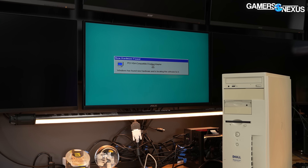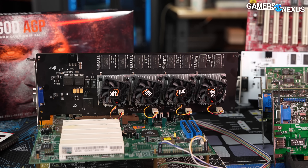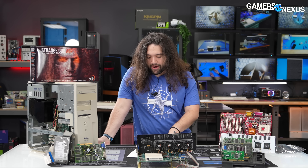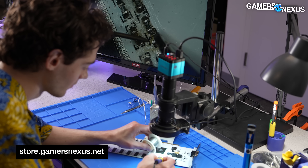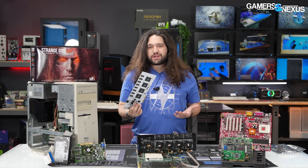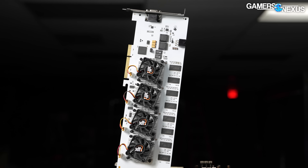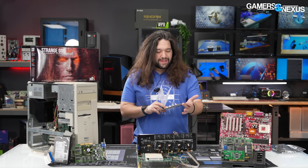We had constant resource conflict problems on the 8K3A due to the unusually high amount of VRAM — the card is modified by Anthony to have more memory than these were ever supposed to have, and Windows didn't really know what to do with it. Our workaround was booting in and out of DOS mode, but the permanent fix was to carefully desolder and move one of the SMDs on the card in order to reduce the required AGP aperture size. After a couple weeks of troubleshooting, we narrowed remaining problems down to the card itself, and Anthony was able to swap it out for us.